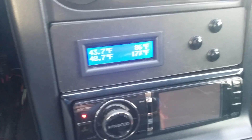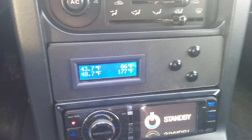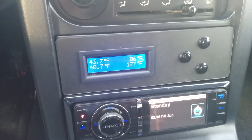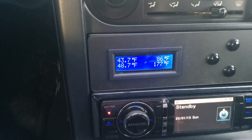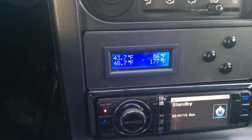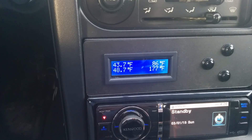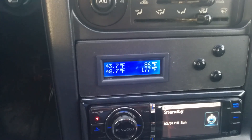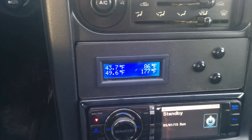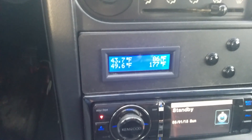There are five screens on here that display different information you can scroll through. The first one is just temperatures. We've got an outside temperature and an inside temperature on the left. On the right-hand side is intake air temperature and coolant temperature — and that coolant one's really nice because the gauge on this car is just a dial with no numbers, so it's nice to see the actual temperature. The inside and outside temperatures are not actually available on this car's ECU; these Miatas don't have those sensors, so those two are separate sensors I wired in for the Arduino — one is under the headlight, and one is tucked underneath the footwell for the inside temperature.